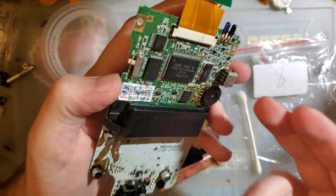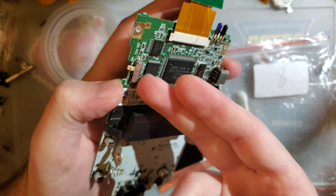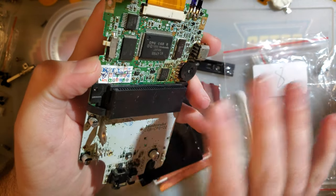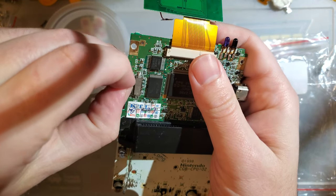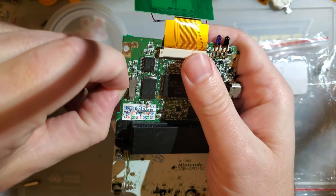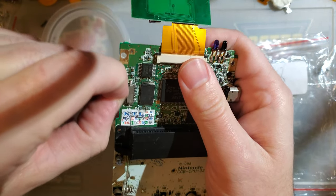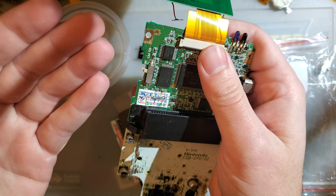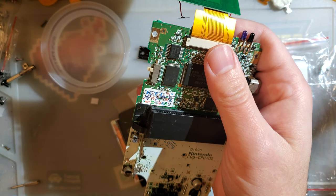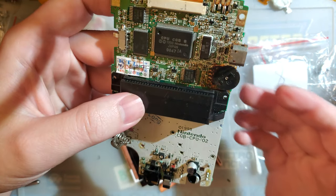But yeah, so if you're getting it in the power switch, I know a lot of other YouTubers recommend the drip and wiggle method. Don't do that. If you're not going to take it apart to clean it, just give it a dry wiggle anyway. Don't put liquid in there. Ta-da. That'll work just as well as the drip and wiggle. And you won't have liquid trapped in your switch that'll cause water damage down the line.